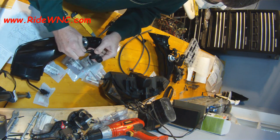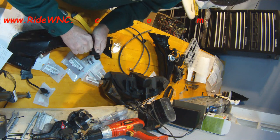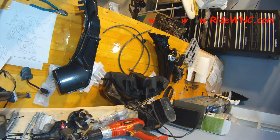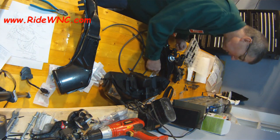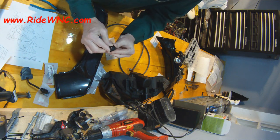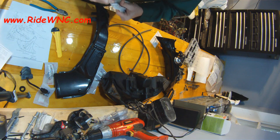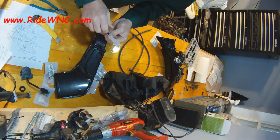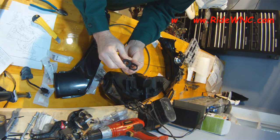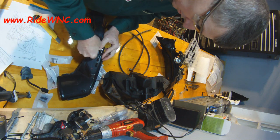As you can see on this vacuum switch, I pulled that little filter off the top. That little filter was another $15 after the $224 for the electronic vacuum pump switch. I think what the switch does is: once you hit 5,500 RPMs, the bike sends a signal to those switches to tell them to open up, allowing vacuum to pull that little flapper door up. Here's a hard plastic grommet — or gasket — which is supposed to hold the velocity box onto the ram air.